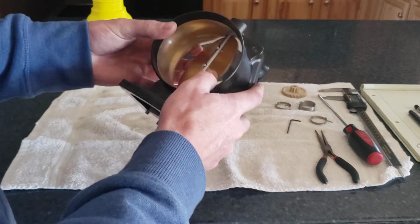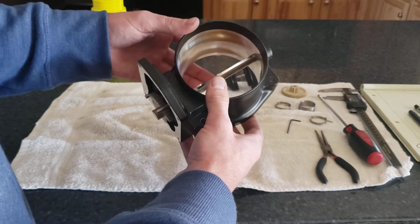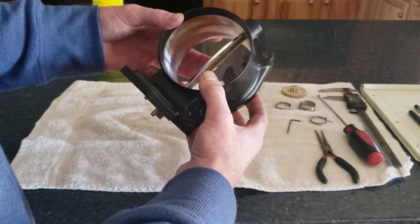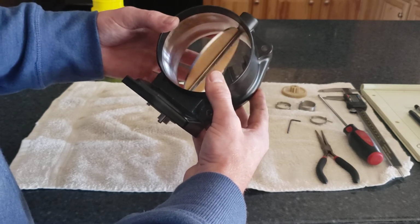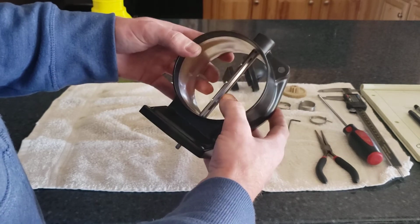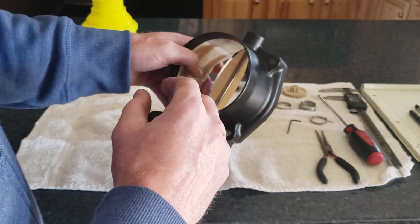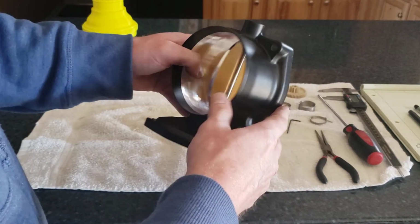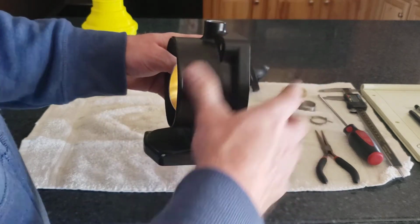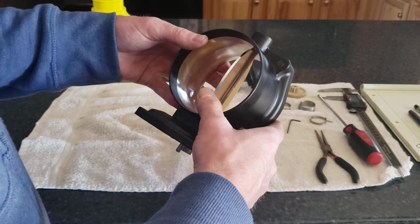So what an electric valve allows me to do is it allows me to have a default position, which is, I've changed the springs in here to do this. So the throttle body or valve defaults to an open position, which is nice because at idle and low load, the air doesn't have to go through the eBoosters, and it can travel just through this large throttle body and make its way with very little restriction up to the front of the car.